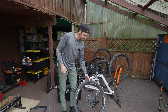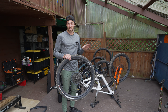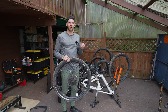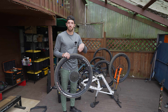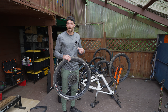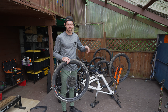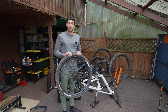I got the tube all installed. As you can see I had a little bit of a struggle — it's been a while since I've done a tube. The tube material itself is a touch slipperier than that original rubber tube, so I found it was easier to seat the bead on both sides, work the bead around, and then slide the tube in after. Quick tip. Also, you saw me sit on my pump — it is broken, so I have to sit on it so it doesn't release the pressure. I need a new pump.